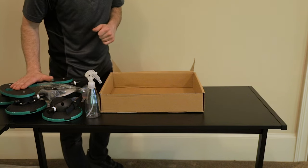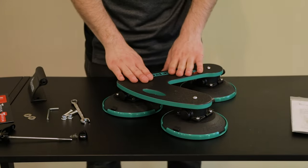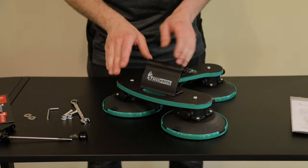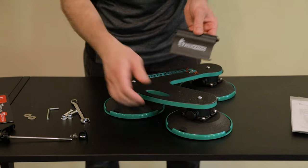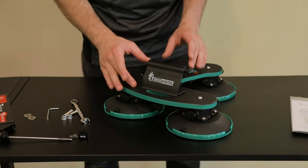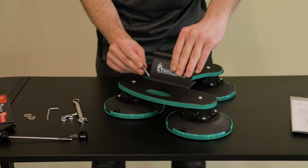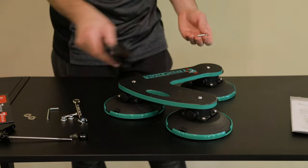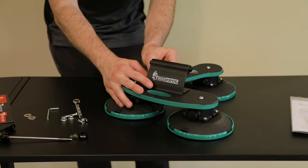The only assembly we're going to need to do before putting it on the car is to actually bolt the bike mount onto the rack. You're going to want to find this handle portion — it's going to go with the logo facing forward. We're just going to put a couple of these allen bolts through the holes in the top, then put a washer and a nut on the bottom and tighten it all up. Line up these holes and get the bolt started.